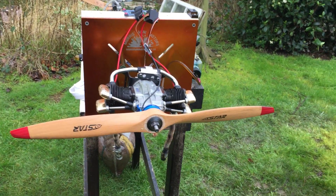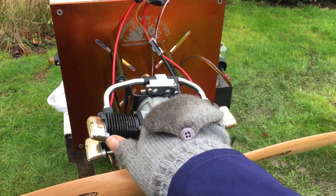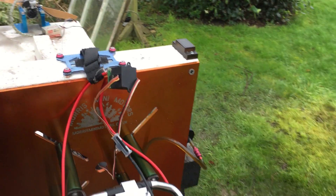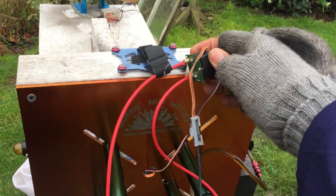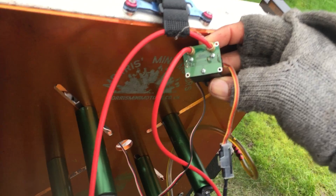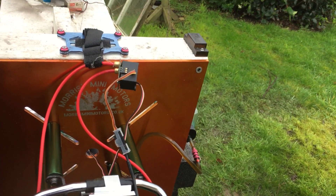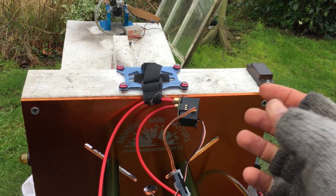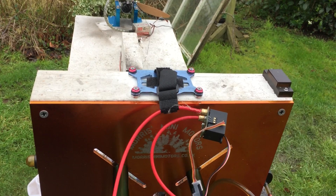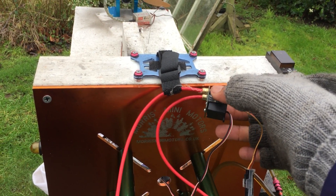Hello YouTube, it's me here again. This is a quick video — I did a video with this engine already with the RC XL ignition. What I'm doing now is just setting it up for a customer. He sent this ignition in; I think this is a Rantranix micro ignition unit made in the UK. This unit is universal — you could either use one lead or use a twin, which is what we set up here. You can just plug it straight in, so you get a male-to-male lead, plug it from the ignition to the regular sensor.